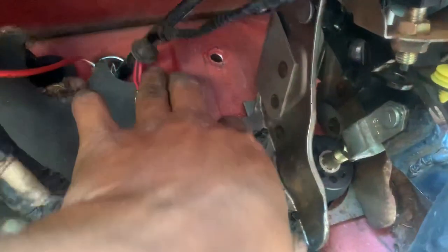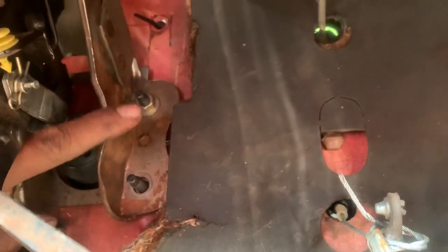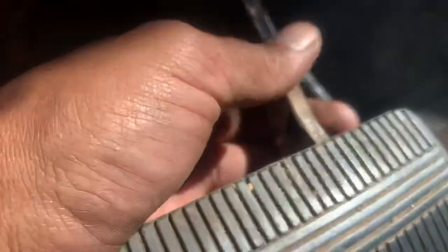See, it came right in — drilled two bolt holes on this side and two bolt holes on the other side, right there. Missing a nut right there. I was able to cut and weld the pedal — we cut right here, used this arc to come out so we can clear the steering column, came down, and I had to weld another little piece right here from there down.